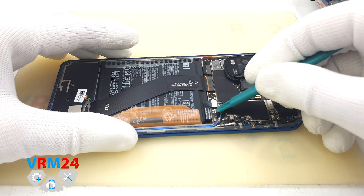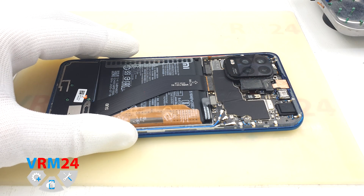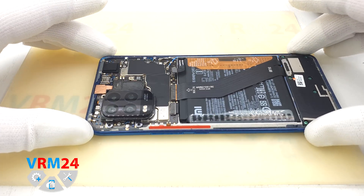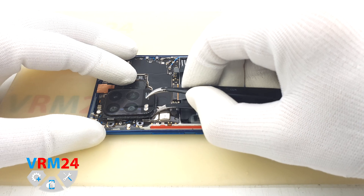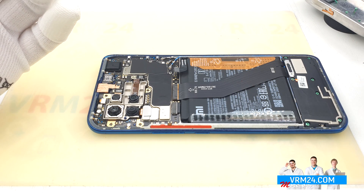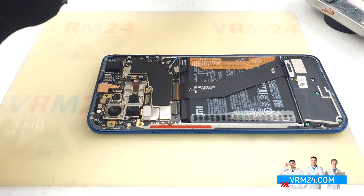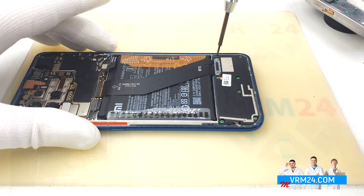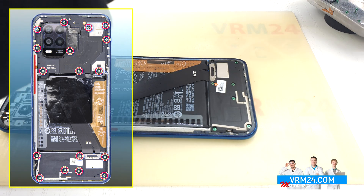We use a plastic tool to disconnect the battery connector. There is a white area around the connector, so in this case it is not safe to use a metal tool. We can try to detach the camera cover — it is heavy. It is not clear what kind of alloy it is; probably ceramic. Also, unscrew the screws at the bottom — they look the same, but it is better to screw them back into the same places during reassembly.